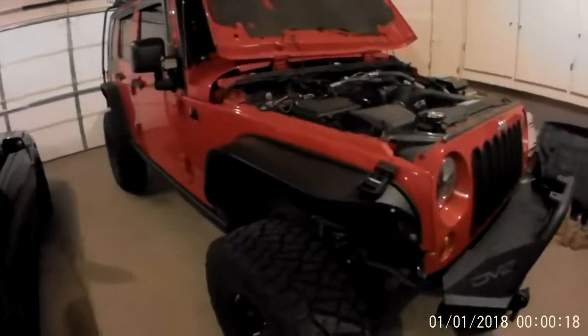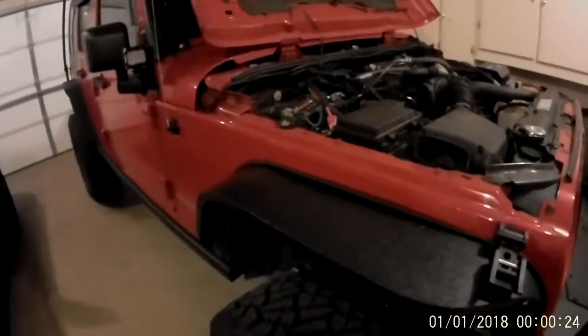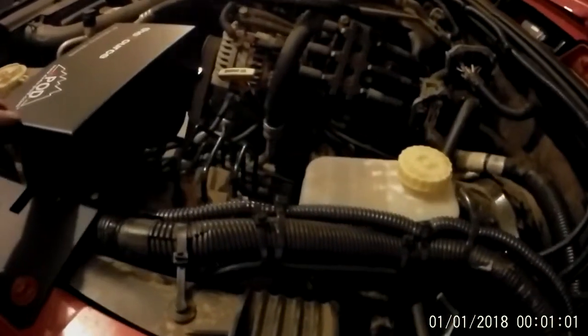Okay, I've got everything installed. I've saved you guys the wire running, zip tying, and cutting, but I'll go over it. Here's one pod light — you can see I ran the wire under the cowl into this conduit tubing all the way across where it meets the other light. Same thing on the other side: wire goes down behind this bracket through a hole under the cowl, into this tubing. I merged them like a Y, comes down to one single wire, and then into my S-Pod.